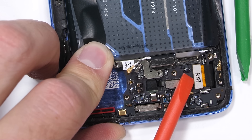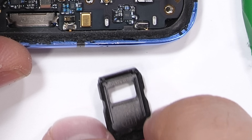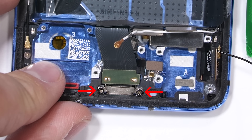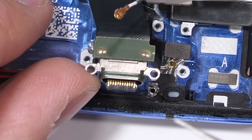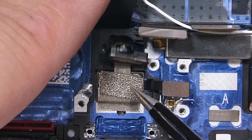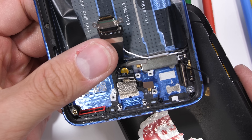The bottom board has three more of the Lego-style ribbon connectors. I can remove the SIM card tray with its water-resistant red rubber ring around the opening. There is one last connection for the fingerprint scanner ribbon in the center of the board, then the whole thing can pull away from the phone. The little USB-C charger has two more Phillips head screws holding it in place, and this time it has a green rubber ring around the tip. When the charging port is smashed into the hole in the frame, that rubber ring keeps water from coming in. Here in the center of the phone we also have the little optical underscreen fingerprint scanning camera — you can see the light from my phone shining back through the fluid AMOLED display.